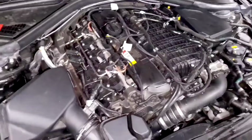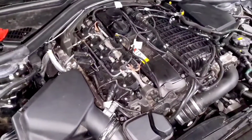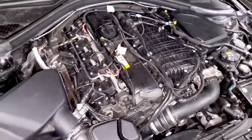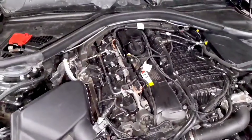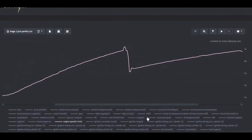So you still can read it from an overall standpoint of if 12.5 AFR is safe on 93 octane, then seeing it in your log indicates you're still safe on your ethanol mix. But it's not going to be exactly 12.5 AFR. It's going to be lower than that. So again, like everything else, you're looking at target and actual. This is probably one of the leading parameters in your car to make sure it's running safe.